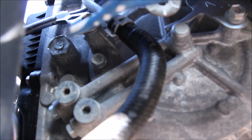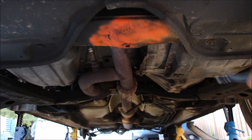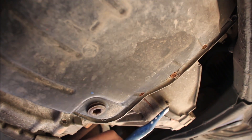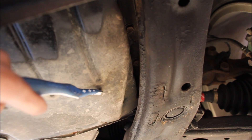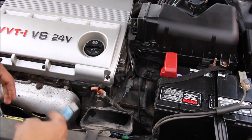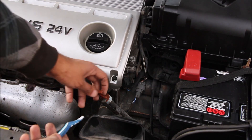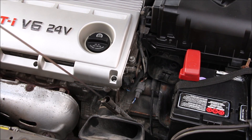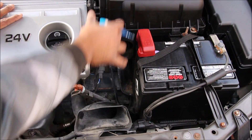The old Camry pumps transmission fluid to the radiator for cooling, and the fill plug is on this side and has to be pumped in. Underneath the old Camry, the plastic ends at the front and the rest is left fully uncovered. The transmission is on this side, the engine on the other side, and the transmission drain plug is over here. The differential is inside this housing before going to the axles on either side. To drop the transmission pan on the old Camry, you need to lift the transmission to access the pan bolts. The old Camry uses a U151 5-speed automatic transmission. It actually uses a traditional dipstick to measure and refill transmission fluid, and the shifter cables are down in front of the transmission. The starter on the old Camry is located underneath the air intake duct.